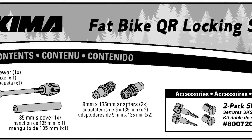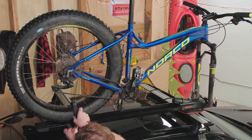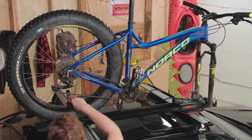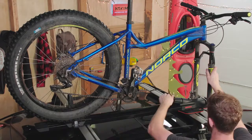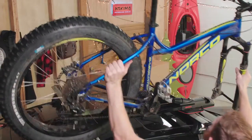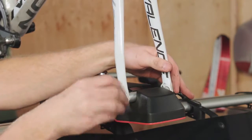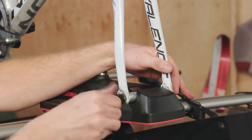Got a quick-release fat-tire bike? We've got you covered — just go with a fat bike locking quick-release skewer. To unload, release the rear wheel strap and tuck it away, support your bike, release the torque-right knob, and grab your bike. For quick-release bikes, you can instead choose to leave the sleeve tightened into the clamp and simply loosen the skewer to free your bike.